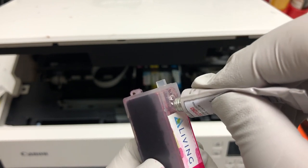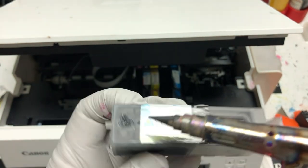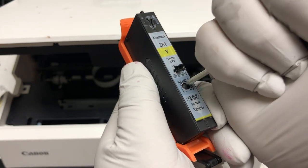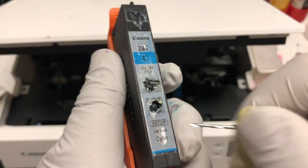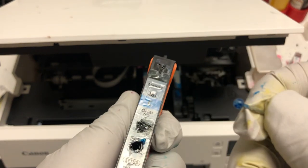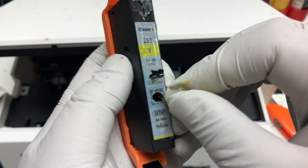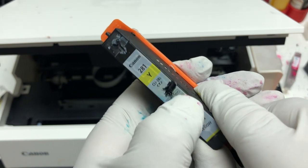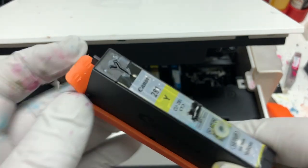The refillable cartridge air hole works the same way — glue it shut or use heat to seal it. To open the refill hole, you can push the ball in, or use a hand drill and drill through halfway and poke it out. I'll just put a link here in case you need the tool. Try to put a sleeve in this hole. If the hole is not deep enough or you have resistance, just use a pair of scissors to enlarge the hole a little bit. The sleeve should fit into the hole completely.